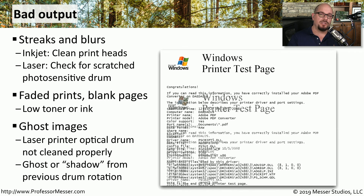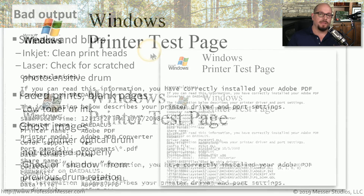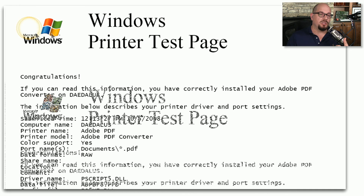If you're using a laser printer and you're seeing a ghosting of an image on the page, it may be that the cleaning process is not working as expected. As the drum rotates, it's printing and then not being cleaned very well, so the next time it comes around you're seeing a lighter version — a ghost — of things that were printed earlier. To resolve this, you may need to clean or replace the components where the drum is cleaned during the printing process.